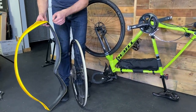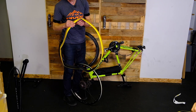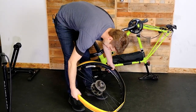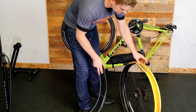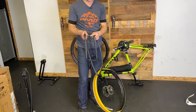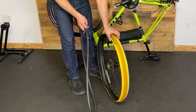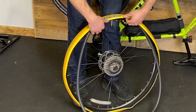Add the pro touch to it — of course you're gonna line your tire logo up with the valve hole. This is a trainer tire, and it turns out it's actually directional. So mount it in the correct direction. We've mounted up our first bead of the replacement tire. It's going to help us mount it well to put a little bit of air in the tube — just give it a couple of pumps, or with a Presta valve you can just blow a little air into it, just enough so it holds its shape. Starting at the valve hole, fold the bead of the tire over the valve hole, place the valve in, and tuck the tire over top of the tube.